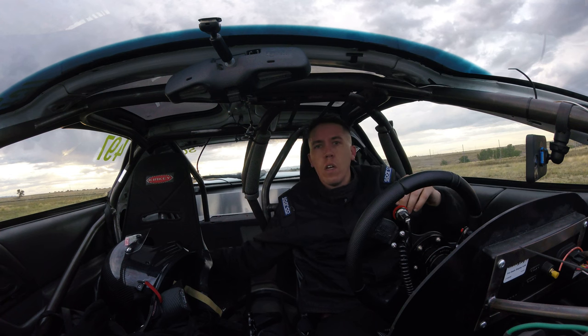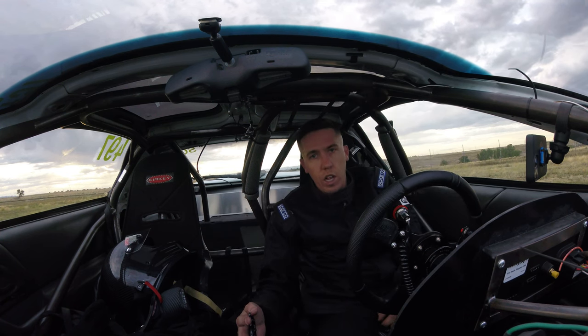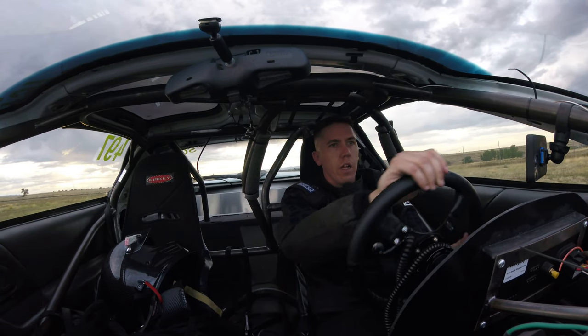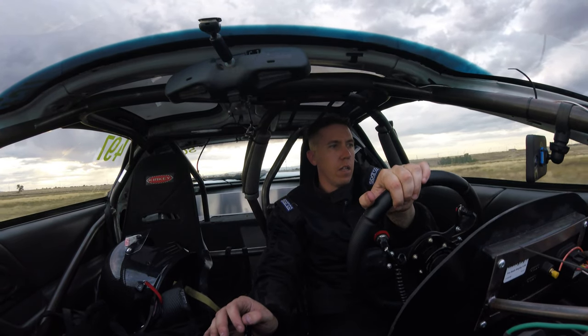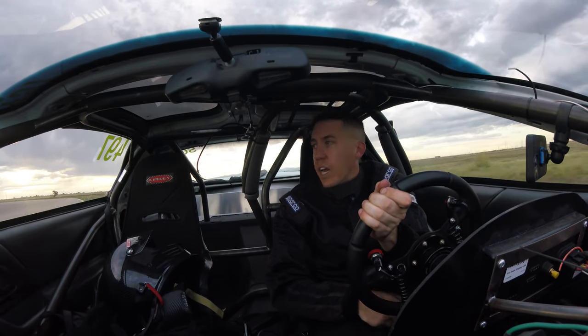26. Pretty good rip. It literally has the same 593 tune-up in it, maybe a hair softer in areas, but easily aggressive up top, and it's still just not going because the climbing's pulling all the power out of it. So I might take the bottom traction control curve and bump it up just a hair, so then it can have a little bit more. We'll see when it's getting into it. Maybe I need to raise it up.